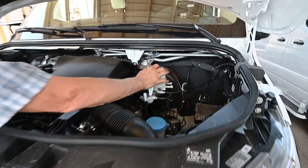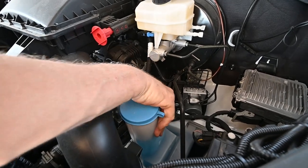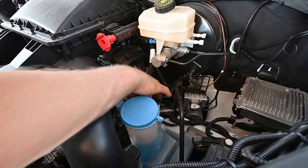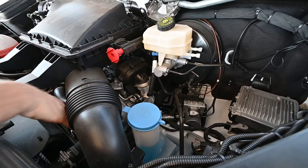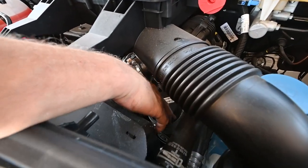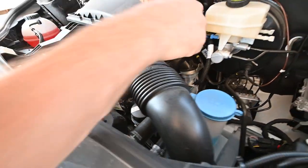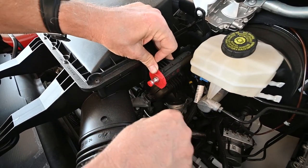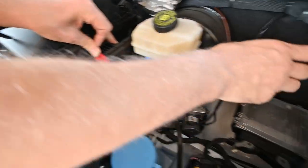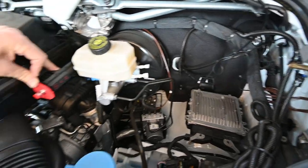I also want to check my brake fluid and my washer fluid reservoir — this is full. There's no power steering fluid; this has electronic power steering. The oil filter would be here at the top — if someone did it themselves, that's where they'd drop it in. We also have a jump start terminal for the chassis battery that starts the engine, so you put the positive there.